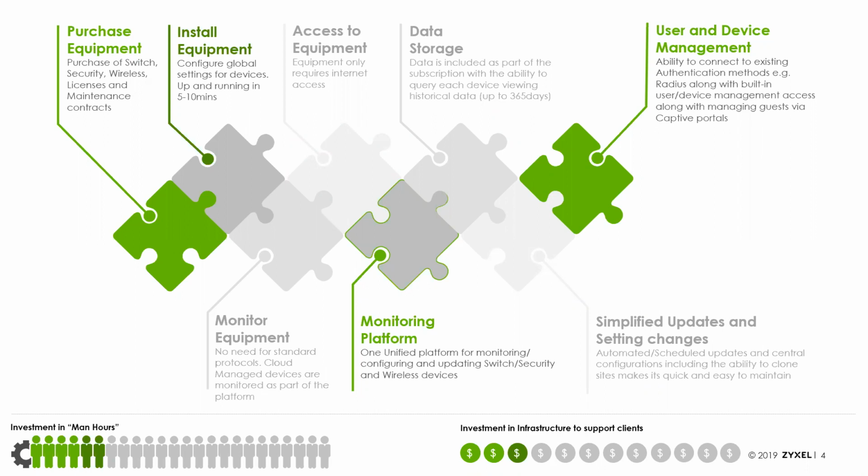You don't need a monitoring platform. The cloud is your monitoring platform. We've got a number of different types of reports and views that you can see. Now, if you do have something you already like, maybe you're already invested into SolarWinds or you really like Zabbix, you can continue to use those. Nebula products can still be managed using traditional SNMP and syslog.